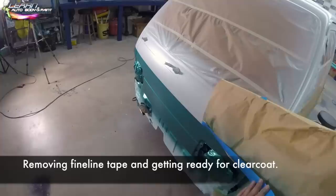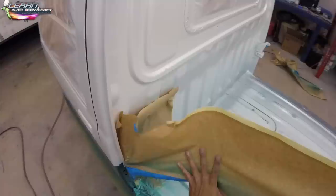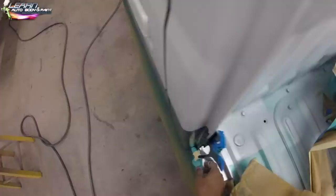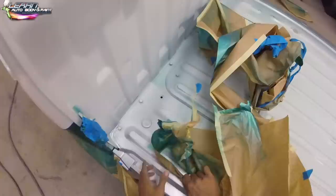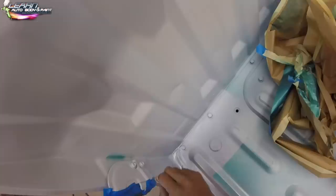What is going on — thank you for watching. Tony here from learnautobodyandpaint.com. What we're doing here is removing the masking tape and the fine line tape, which is the darker blue skinny fine line tape. It's about one-eighth inch wide — they also have a quarter-inch wide. Fine line tape is used for making graphics, doing pin striping, flames, and separating colors on multi-tone paint jobs. We're removing it because our three-tone paint is already done so we can spray our clear coat over everything.